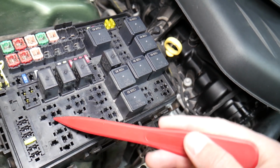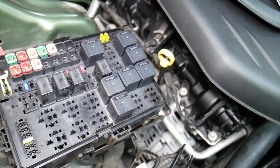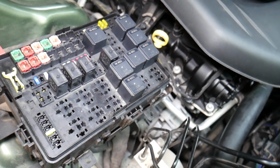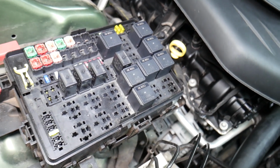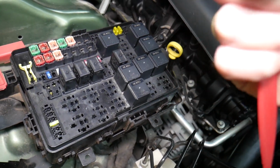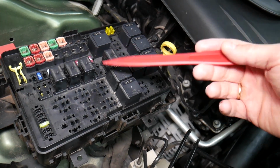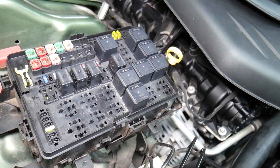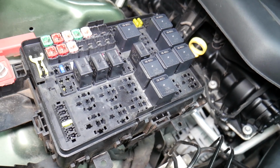And for some certain fuses, it's important to disconnect the car battery when removing them, otherwise you can burn the electronics. And for instance, working on airbag fuses or anything like that, you need to wait at least 1 hour after disconnecting the car battery. And if you're not qualified and certified to work on airbag systems, I will never recommend doing that. But when disconnecting the car battery, common mistake people make, it's important to know which battery terminal you reconnect first. If you do it the wrong way, you can burn electronics modules. How we know about that? We burned a traction control module on a BMW that cost us $2,000. So we'll put a link in the description of the video below which battery terminal to disconnect first. Check it out for your convenience.